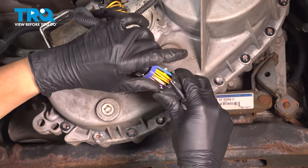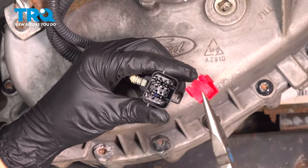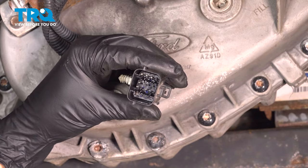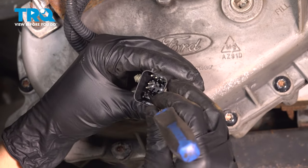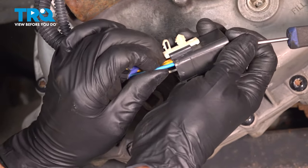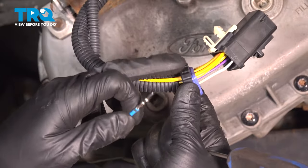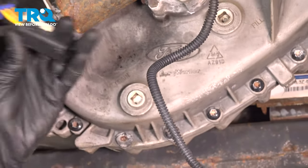Just peel this back enough to make room to actually get a pick in here and pull this wire out. With a pair of needle nose pliers, pull out the red insert — that's going to allow you to pry the little locking tabs for the pin out. By doing that, you can unlock the wire. Use a pick or anything else that'll get in there, push it up while at the same time pulling the wire out. Once you pry that out, you should be able to pull the wire with the end terminal straight out. Then take it out of the rubber/silicone grommet and the back side of the harness. Unwrap it from the rest. This will stay with the vehicle — we'll plug this into the new connector, and this will come off with the motor.